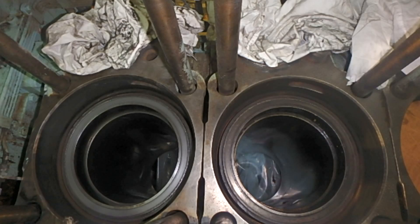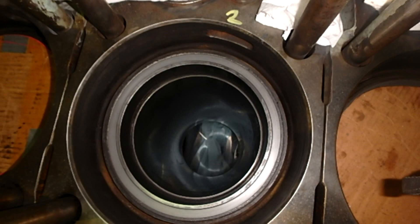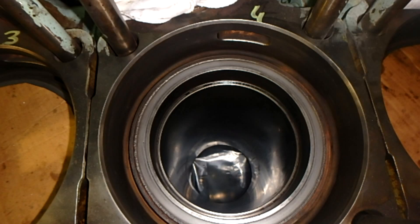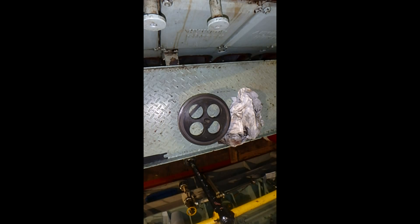This is the correct way. As you can see, I use a rag to clean the surface thoroughly so any remaining dirty material is removed. This is the surface after grinding. We must check the roughness details — it means that in some hours the cylinder liner must be replaced. Here you can see the difference between the clean one and the dirty one.